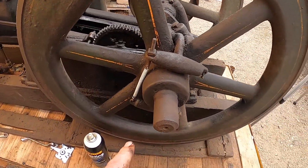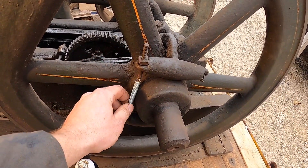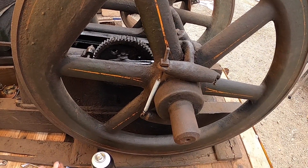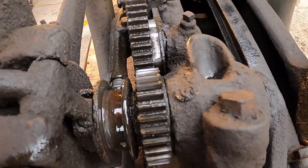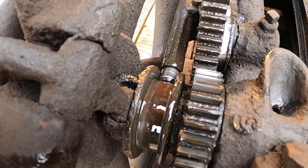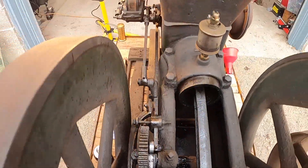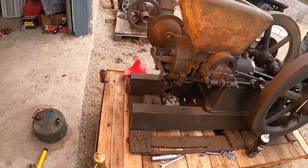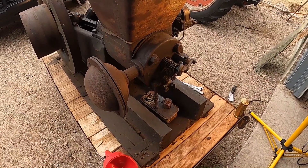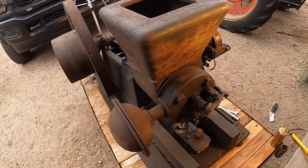During the video, as time went on it would speed up. I only got one spring on here on this governor weight and I think that has something to do with it. As the engine warms up and starts to fire more, I really need to get in here and get this crud cleaned out. I think it'll run a lot smoother. I'm happy with that — I think she has been running a little rich and I need to mess with the fuel system some more.